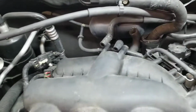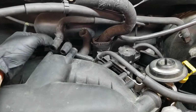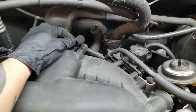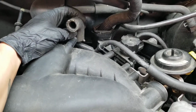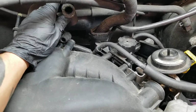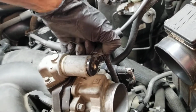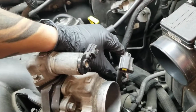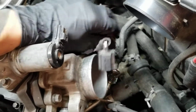At this point, you're gonna disconnect the power booster hose, which is this one. Boom. Vacuum, which is this one. Boom. This hose right here is most likely from the valve cover. Remove this one. I have this bolts loose already. This one is connected. Any plug you see, just pinch and out. Pinch and out.